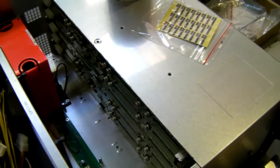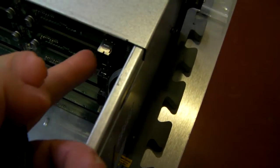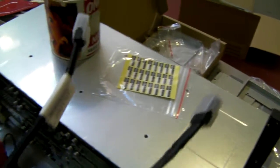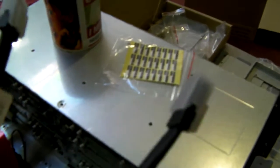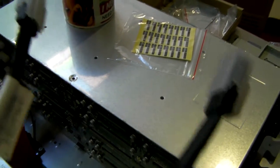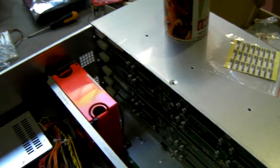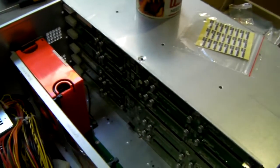When people are building these they often ask about the cables, because the mini SAS ports are on one side of the chassis. The best cable if you're using an 8087 cable is the shortest one, which is 0.5 metre. If you get a 0.6 or 1 metre then you're going to have a lot of excess cable.